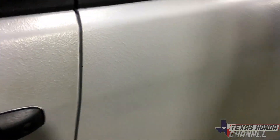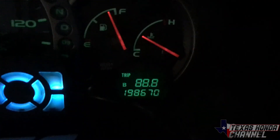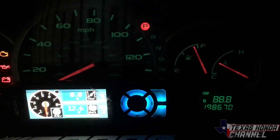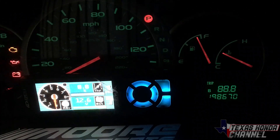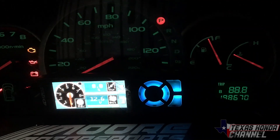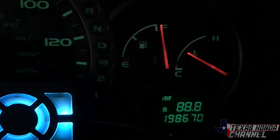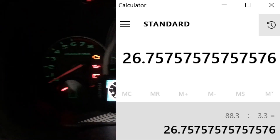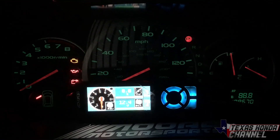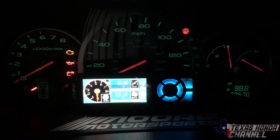I stopped in Winfield to go to the bathroom — good time to check in. We've gone 88 miles and I'm just barely off full. Air fuel ratios look pretty decent. I'm going to lean them out just a little more since we're cruising — probably high 15s to low 16s, as long as there are no drivability issues. I now have a full tank: went 88.8 miles and only used 3.3 gallons, which is about 26 miles per gallon — better than what the stock pilot gets from the factory. The fuel mileage definitely went up from the Bestline, which usually does increase fuel mileage.